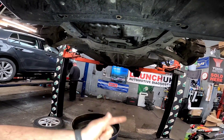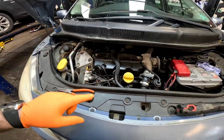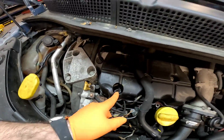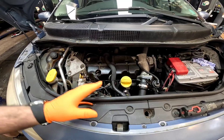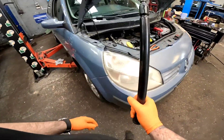Get some fresh oil in it, give it a good start, and that is the vehicle now all put back together with a fresh oil filter and a new sump plug. We put the correct amount of oil in it. What I'm going to do now is unplug the fuel pump and also the fuel rail pressure sensor — that should not allow the vehicle to start. Let's get on the key now, we're just going to build that fuel pressure and oil pressure.